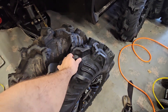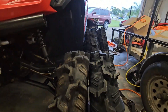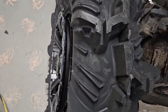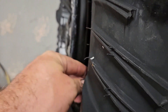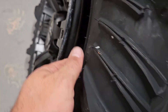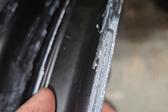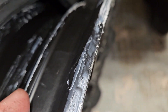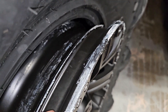The bead's got a weird lip and taper in it. Because of that, these tires are going to have to have a lot of air in them, which is not good because I wanted them to be shorter than the 33s. Having to run so much air pressure, they're going to be almost the same height. When I run my 33 bead locks on the Pioneer or the Can-Am, I have zero PSI. I think I've figured out why these rims are cheap — this bead lip is pretty far from the rim. The tire bead is only so fat, so once it sits here it's not going to push all the way out. This radius is too big, so the tire can't seal up against this part of the rim — the spacing from the bead to the rim is too large. This is like an automotive-style bead, not a low-pressure, low PSI bead. That radius is terrible.